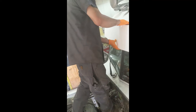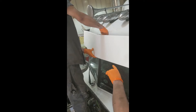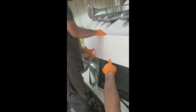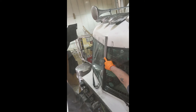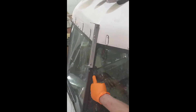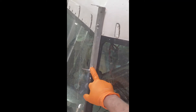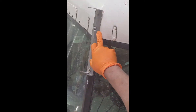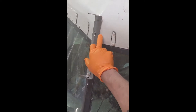What Billy did in the middle: when we had this all bolted in, he dropped the center bracket in there, found out where it was going to be, made a mark. We removed the visor, he held it in place, and drilled holes. You've got to be careful when you're doing the windshield — you're hitting metal in between the windshields. If you have huck rivets available you can do that, or they're going to be through-bolted up here. Huck rivets are the best thing because you can't get to the back side of that without taking apart your whole console.